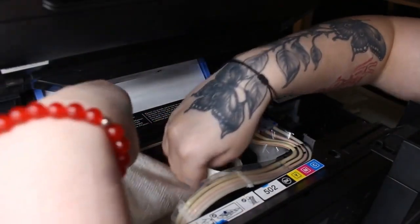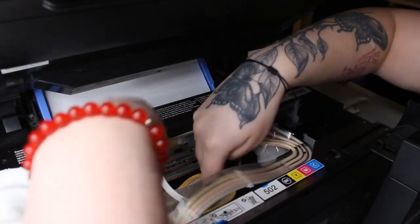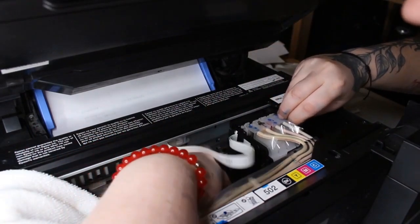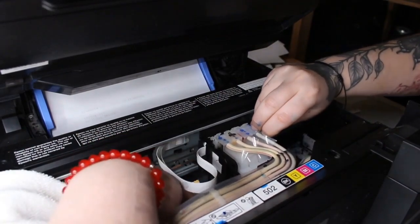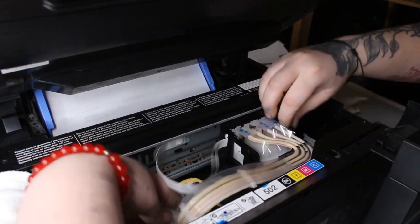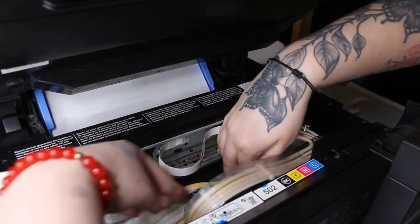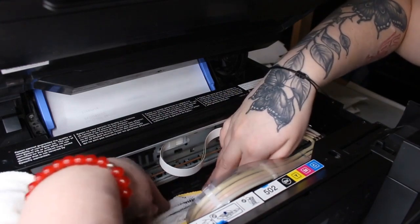We're going to use a method called the shoe shine method. You can get a cloth or a napkin, wet it down a little bit with just some water — it doesn't need to be soaking wet. You're going to lay that cloth or napkin, whatever you end up using, in between the rail and the star wheel. You see it kind of gets bunched up there, but try to lay it flat the best that you can.